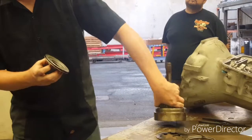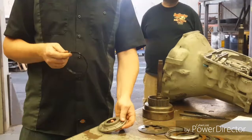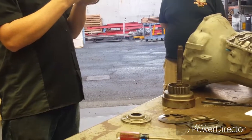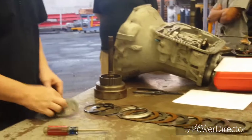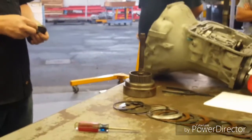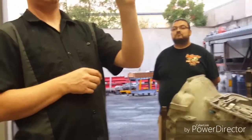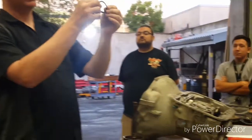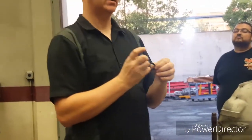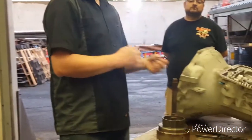Now in here there's nothing left to do, so we'll set it aside. And on the piston — very carefully pull your seals out. Last time we pulled them out and put them back on, but to pull them out — same thing — you can see I can run my fingernail across this and nothing's catching. What does that tell me? There are no tears or nicks. So I'm going to take that out. If I'm reusing a seal, that's what I'm going to do, but if I have a brand new one, I'm just going to install it and not worry about it. But if I open up a transmission just to do an inspection and replace one broken part, I like to check them just in case.